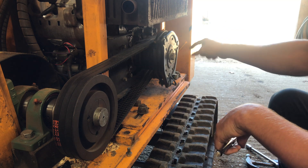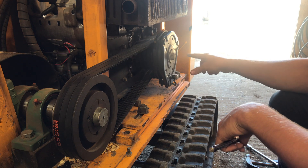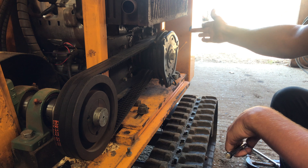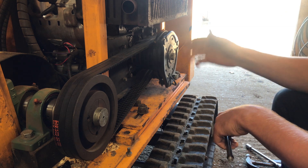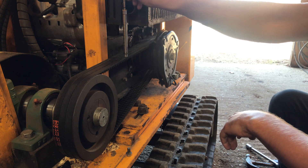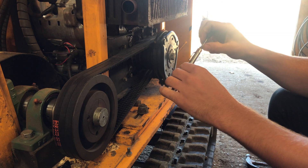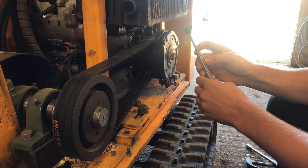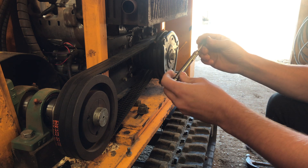By releasing these 30 mm nuts by about half a turn each and tightening the 24 mm clockwise — it's located at the center rear — slowly doing it and keep checking our adjustments, we can then work out exactly how much force has been applied, which means I can bring this up to say 2.5 kilograms of force.